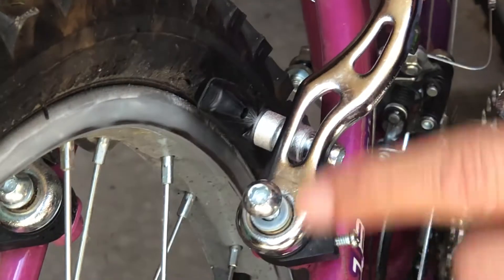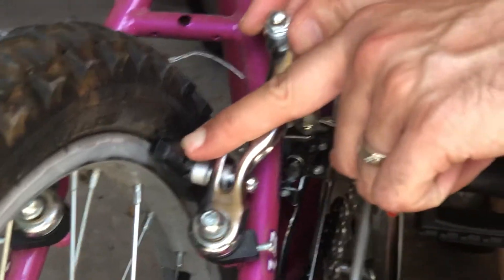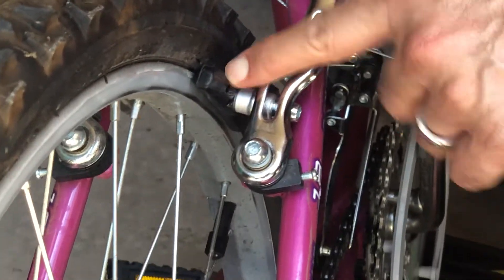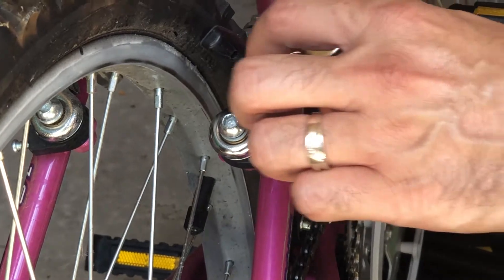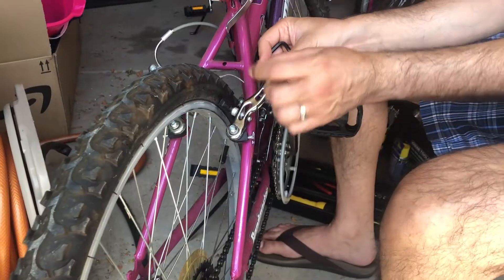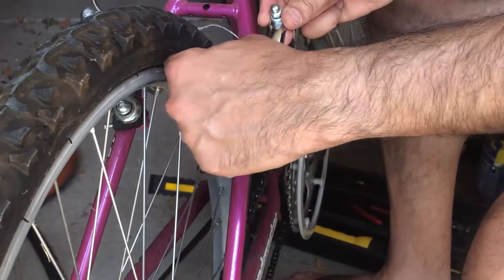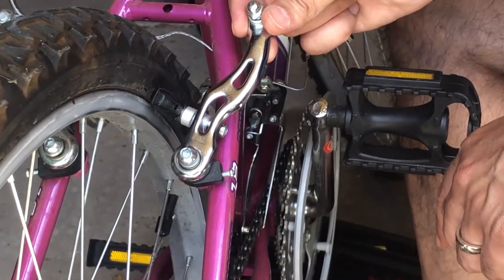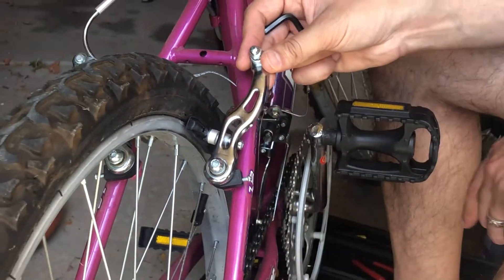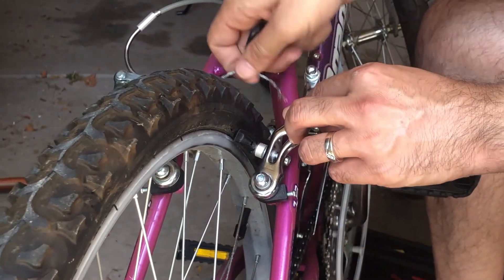You have to make sure that the brake pad is aligned with the wheel frame, which it is. You put this metal piece on — maybe not screw it all the way just yet. Once you do that, you align the brake pad to the frame so that you get a nice snug fit. These washers are oval-shaped, so they allow you to move it up and down to align it flush and parallel to the wheel frame.